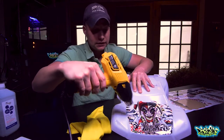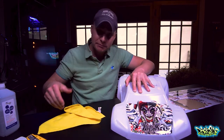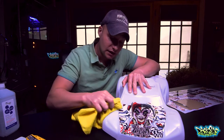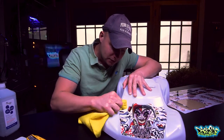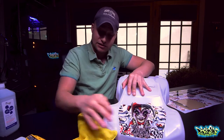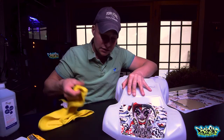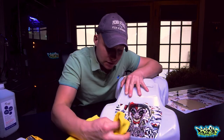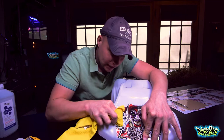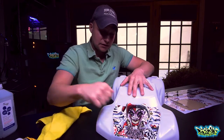This is designed assuming you have not cut the vents out yet. If you have cut the vents out, install over top of the opening and then trim it out. If you haven't cut the vents out yet, install like I am, and then you can come in and trim it out once the graphic has been adhered. I'm just going over the graphic now. This entire thing is down from this center line over, with the exception of this depression. I need some serious heat to get that depression in the vent to go down. I'm going to find the depression starting at the edge, work towards that air hole, then down and towards that hole — and that's it. Done. It's solid.